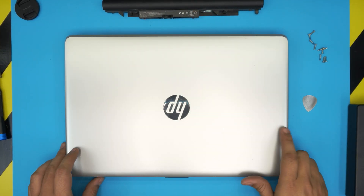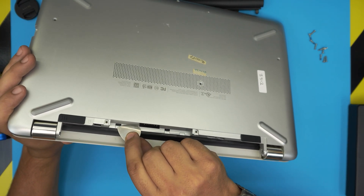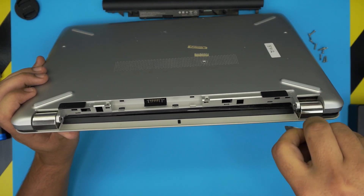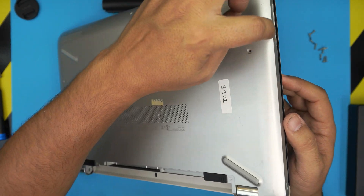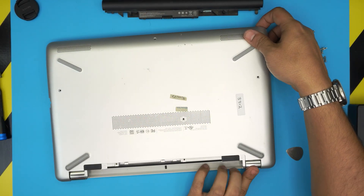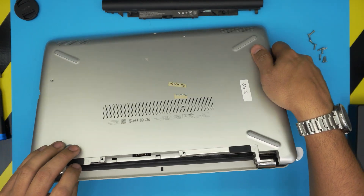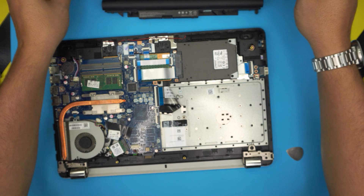Once that's done, close down the screen. At the back there are two fragile clips — don't worry too much if you break them, nothing critical will happen. Don't just lift straight up or you'll break them. You can release the two triggers here. To release the clips, grab the cover at the corner where the SD card reader is, put your finger right on the hinge, lift it slightly, and bring it towards the battery side. Once you do that, those two clips will release.